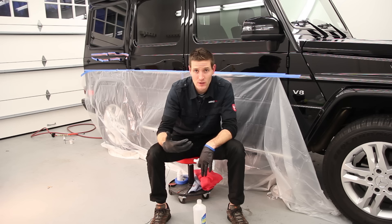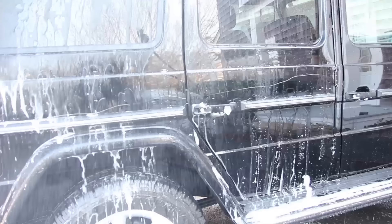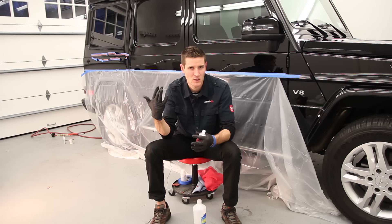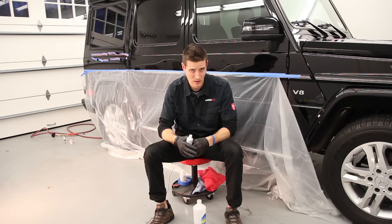We pulled the car inside. Before I did that, I actually did a few things to make my life easier. First, I cleaned the wheels and washed the car. On the scratch itself, as I was washing and soaping it down, I did a little bit of claying. The reason is forethought — knowing I'm going to have to polish with a three-inch RUPES polisher, I didn't want any contamination sticking up and having my pad go in there. It took 30 seconds, and I wanted to wash everything down so I don't have to redo everything when I present the car back to the owner. I used the air compressor to make sure there was no water in the cracks, because this car, much like a Hummer, has little intricacies where water gets trapped.